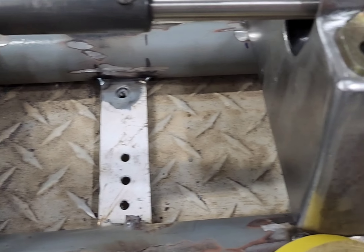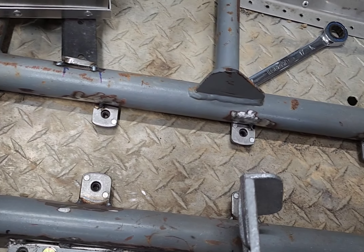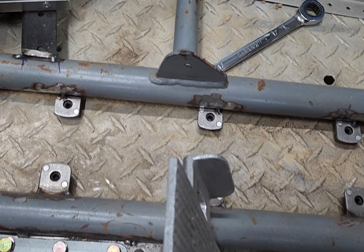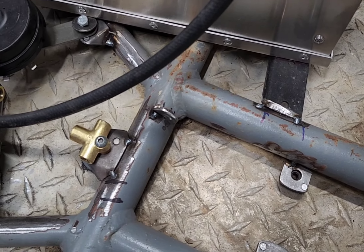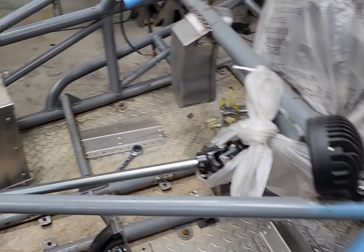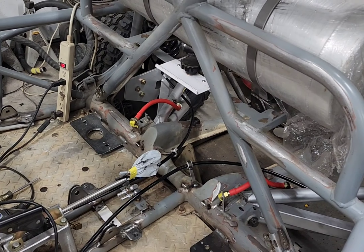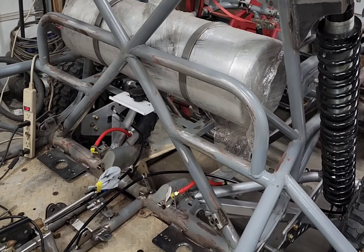I have my brakes and emergency brake all mocked up now — everything's ready. The emergency brake cuts through there, and there are the two mounts I made. They'll get cut to length and join up at the junction. I've got all my tabs tacked in for wiring and brake lines all the way to the front, with tabs for wiring on top and brake lines on the bottom. Everything is mocked up for the brakes and all the tabs are in place. Tomorrow I'm going to start laying out the tabs for the wiring, and then it's going to be time to break it down and start painting.